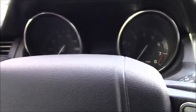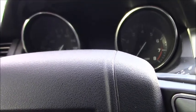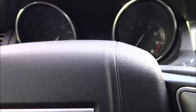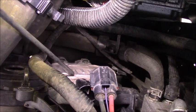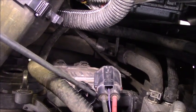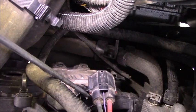You can see right now the key is off and everything is quiet. Let's go under the hood and I'll show you something. The fan won't run anymore, as you can see down there. This is the radiator fan control module. As you can see, there's one connector here that I already disconnected — that's why the fan stays off.